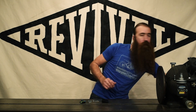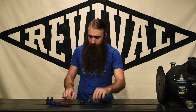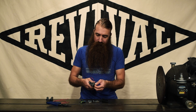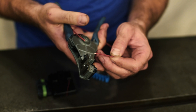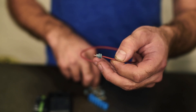To assemble this, you're going to need some wire and some tools: a wire stripper, a side cutter, and a crimper. First up, strip back a bit of the insulation. You only want to strip back about an eighth of an inch — you just want to make sure you get a good crimp on that terminal. If you've got too much wire stripped back, the terminals are a little bit tricky. Now we can slide our cable seal into position and bring our terminal in.